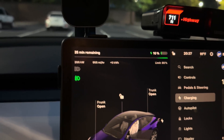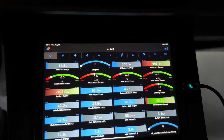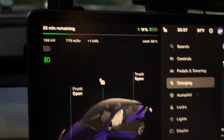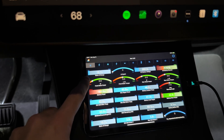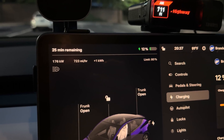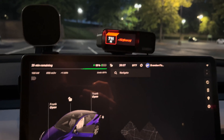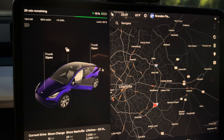It's ramping up — 200 kilowatts, 211 kilowatts. I've got Teslax down here where you can see charging current. It went up pretty high peak and then it's already dropping down. The state of charge shown in Teslax is different from what's on the main screen — that's totally normal, because Teslax shows the true battery state of charge whereas the display shows available charge without the buffer factored in. We're going to run this for 15 minutes and see what we get up to — I think it'll reach about 60% or so.